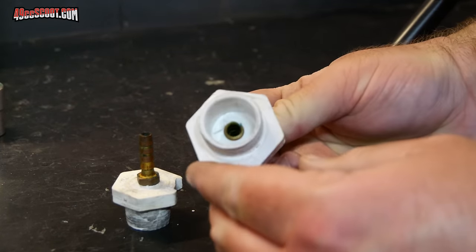Whenever you have a leak, you're going to need some sort of water and soap solution. A lot of people use dish soap and water in a spray bottle. I use something like Simple Green and water, which works fine for me. What you're going to do is spray it around anywhere there is a potential for a leak. There are all sorts of places a two-stroke can leak — it could be the intake, it could be your connection with your test rig, or anywhere in your test rig itself — at the hose barb, before your gauge, or where you've connected your pump.